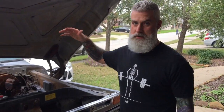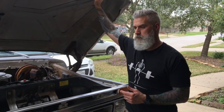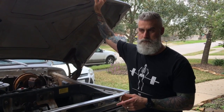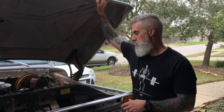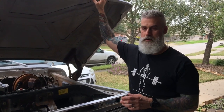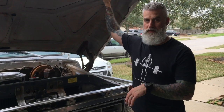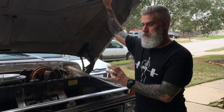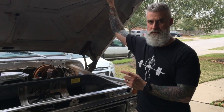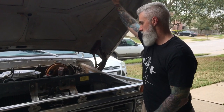And so we had the same kind of deal. We were like, what are we going to do? We're going to find the parts. Well, the shop I had it at, they farmed that piece out in particular because they didn't know how to solve this problem. So they took it over to basically a steering and suspension specialist guy. And one of the things that he said was he comes across this whenever he works on these old trucks, and what you have to do is get a universal coupler. It's universal, but that doesn't mean it universally fits right out of the box. You have to customize it, grind it down to the size you need it to be, drill the holes to the size you need to fit into the housing for that coupler. So that's what we did for the steering.